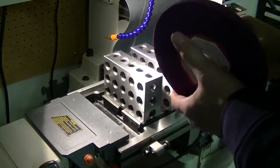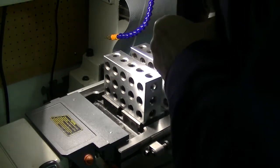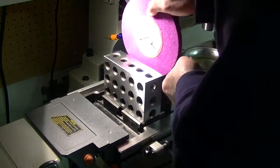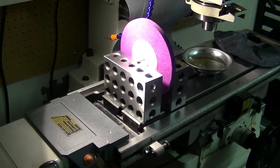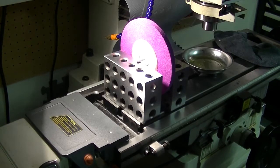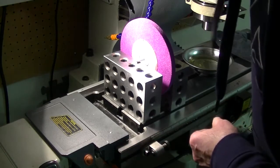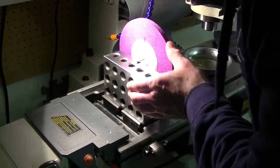This is cheap, easy, and works really well. You basically just push the wheel onto the assembly - everything is a nice tight fit. Then just set it up and let go, letting it drop to the heavy spot. You'll see it swing back and forth - this can take 5 to 10 minutes to settle. I already marked a point where it settles, and now I'm going to grab a marker and mark the high spot or the light spot on the wheel. On the opposite side I'm going to take off some material.